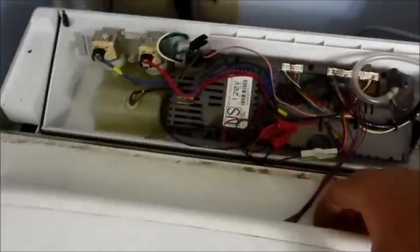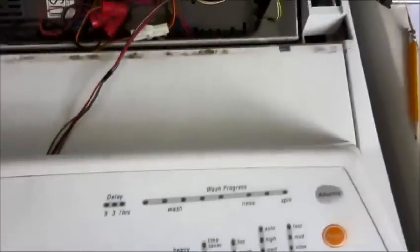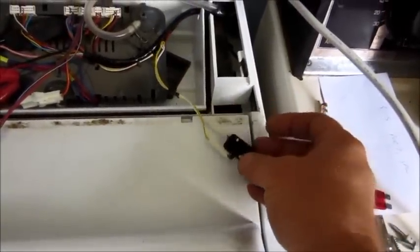I've taken all of the electronics out back here — both the motor control and this board — and checked for any signs of damage. Everything looked good. The problem turned out to be this balance switch. I don't understand why in the program it affects the filling, but it does.